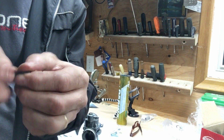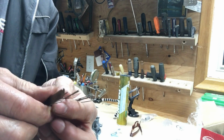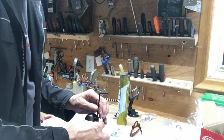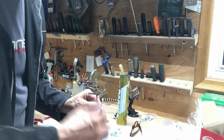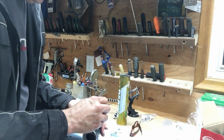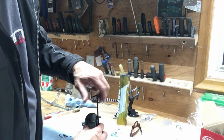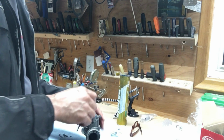Knurled aluminum chuck. And you could put in these little tiny drill bits like these things, and chuck it in there, and then you just drilled it by turning it with your finger. The guy I worked on motorsport with back in the 80s, that's what he had. Because I would drill that other idle circuit out a little bit bigger, maybe drill both of these out. You can always adjust the fuel down with the air mixture screw. That's what I'm thinking.